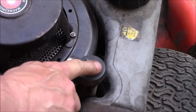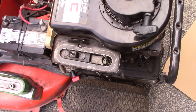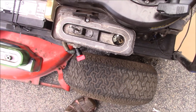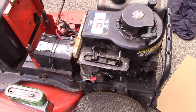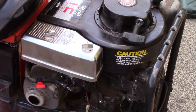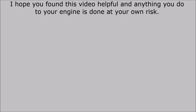After that we'll fill her up with oil and put some fresh fuel in there. Looking straight down in here, everything is dry — that was filled with fuel before, running through the oil breather and filling the crankcase. It looks dry now, so we're all ready to go. I filled her up with oil, we'll put the air filter on and fire it up.